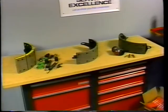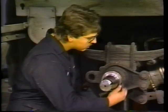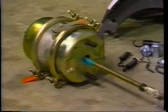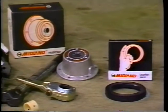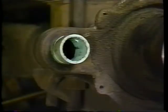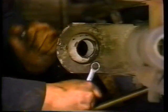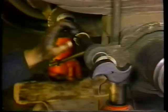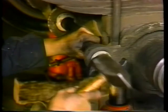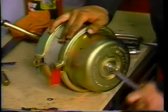Other compounds available in the Greyrock line are formulated for specific brake types. Now the brakes on this vehicle can be trusted to operate efficiently and safely with the correct brake linings. Follow these procedures for cam brake reassembly with the appropriate replacement parts. Install the camshaft bushings and seals in the brake spider using a suitable tool. Make sure all parts and retainers are carefully aligned and tightened. Install the camshaft into the axle bushings.